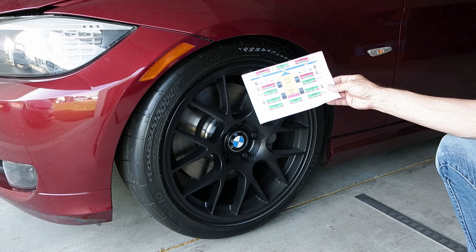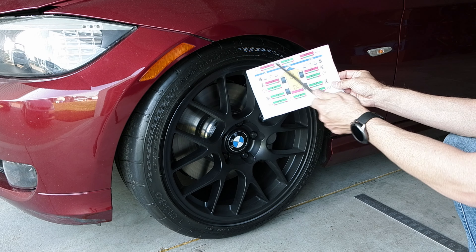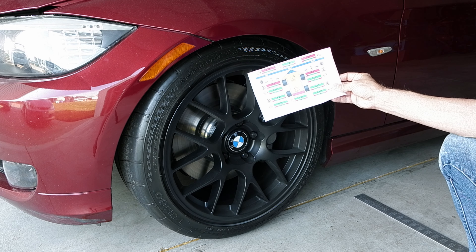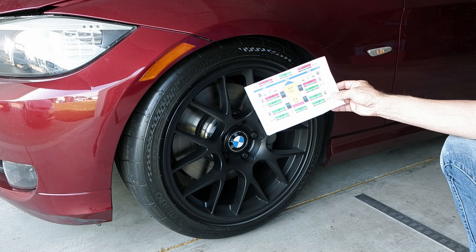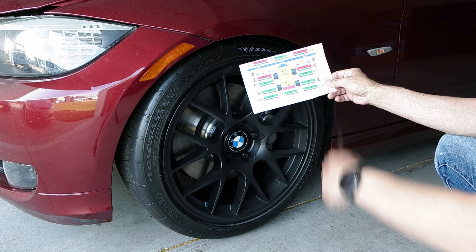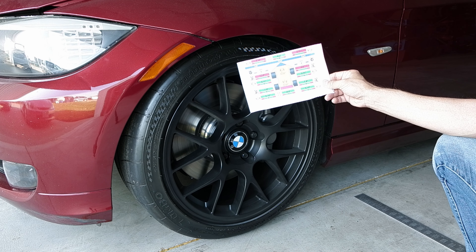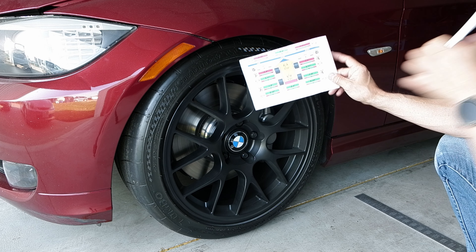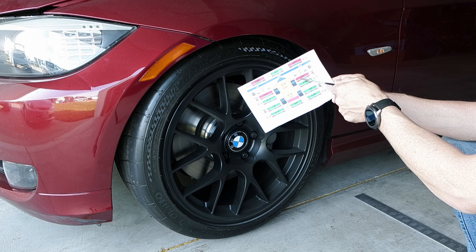The car was aligned on all four wheels, and here are the final results — the most important part of this video. The front negative camber is minus 2.4 on the left and minus 2.6 on the right. Everything is shown in green on the alignment printout; the only red is the camber in the front. I pretty much have everything else aligned to factory specs — I didn't ask for anything special with the toe.